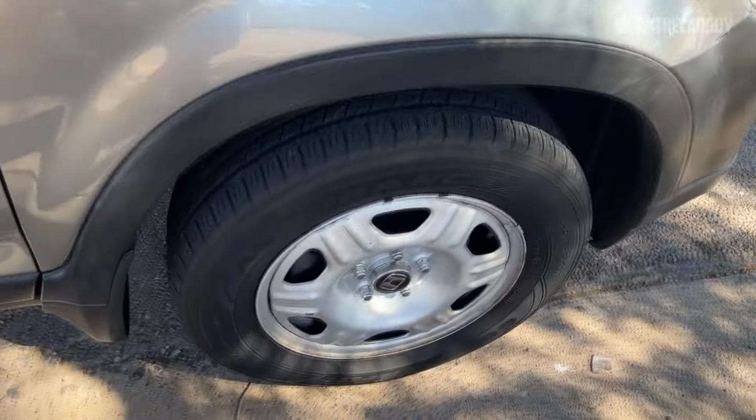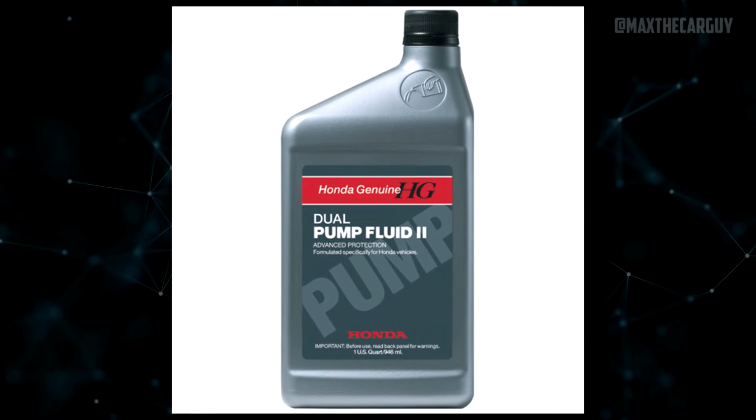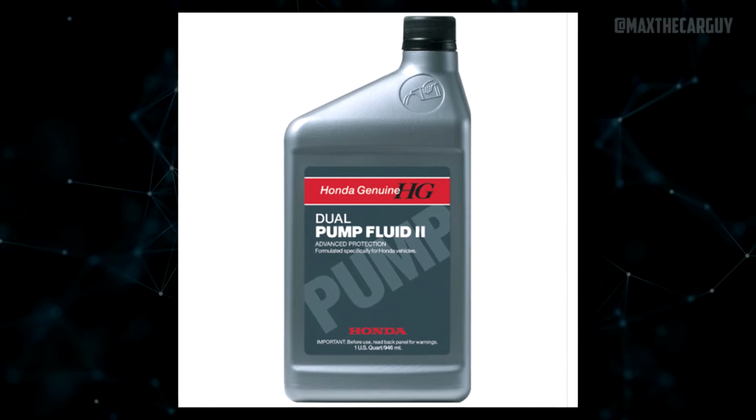A vibration in drive position could result from a bad engine mount. By replacing the fluid in the rear differential with the Honda recommended dual pump fluid, you may be able to stop the shuddering from the rear axle during low-speed turns.